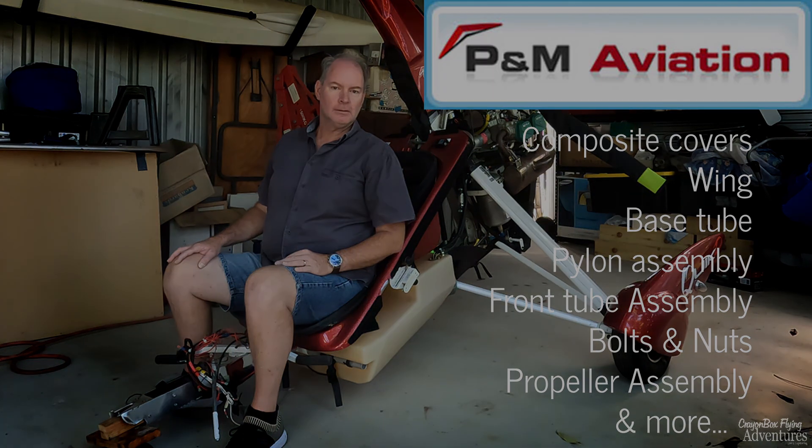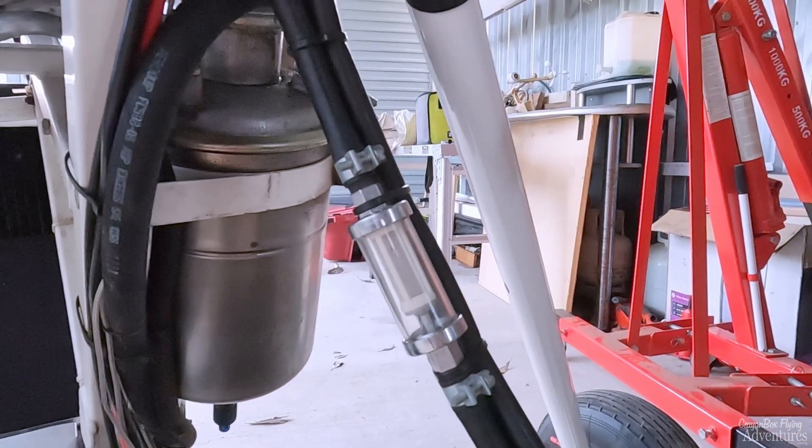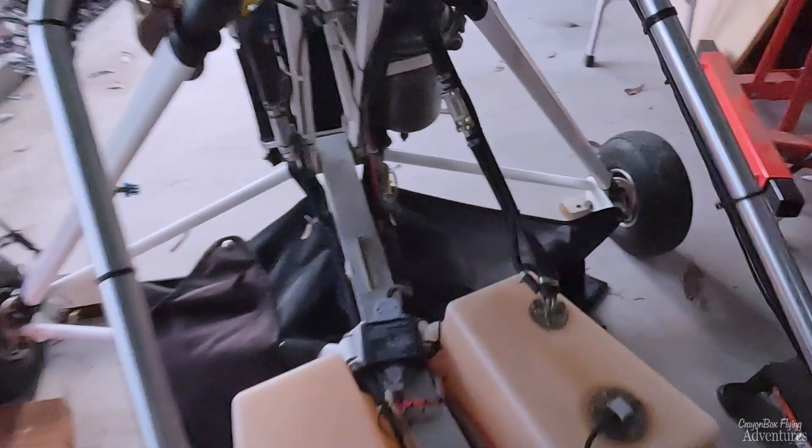I've just noticed there's no fuel in the pickup, so maybe it just hasn't got enough fuel in the system. There are three things required to make an engine run: spark, fuel, and air - plus rotational energy. We know we've got rotation and oil pressure, but we've got no fuel. So I'll work on getting fuel - there's also the air fuel filter to consider. Maybe there's just not enough fuel in the tank.